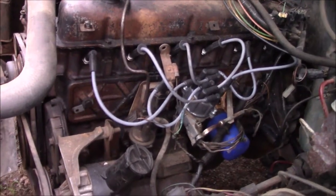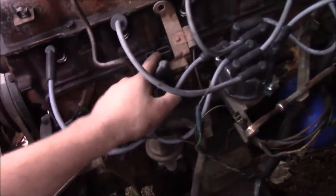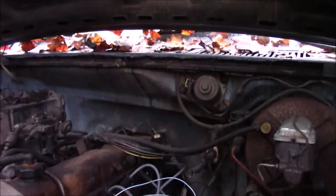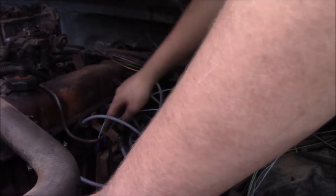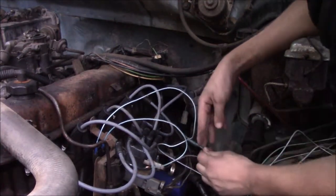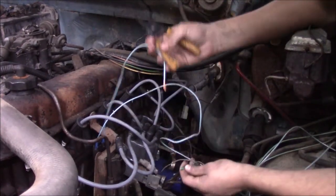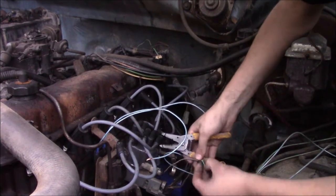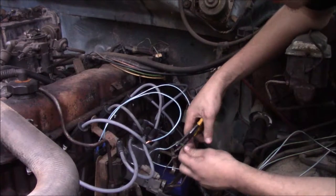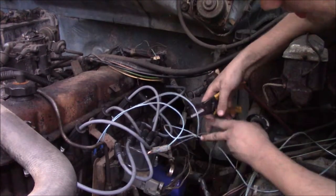I'm going to try to rig something up to work, just to see if we can get this thing to give us some spark. When I pulled the wire off this coil right here, I actually broke it. It's this one right here that's already been spliced one time. I'm going to cut it closer, because I'm going to try to cut that splice out of it. This one right here was the one going to it - I'm going to strip this wire back. I can't pull it off, I don't want to break it. So I'm going to strip it off and tie it in. And I've got to redo this one too, because I have to cut this plug off.